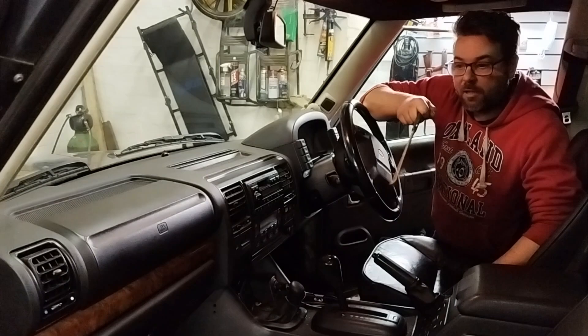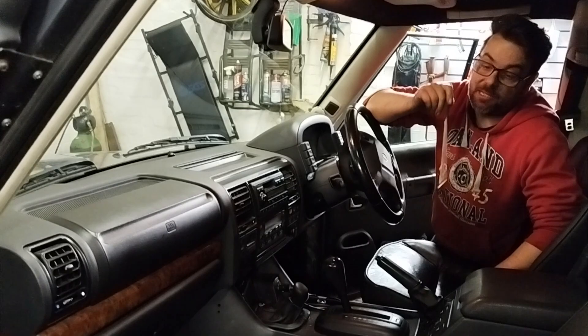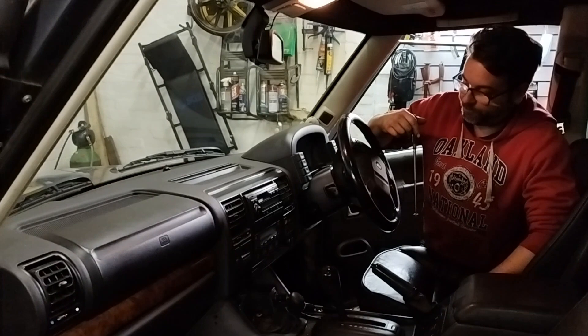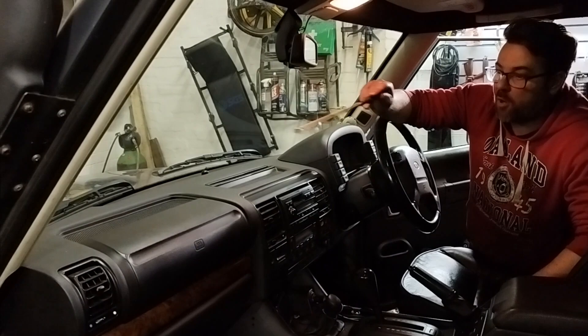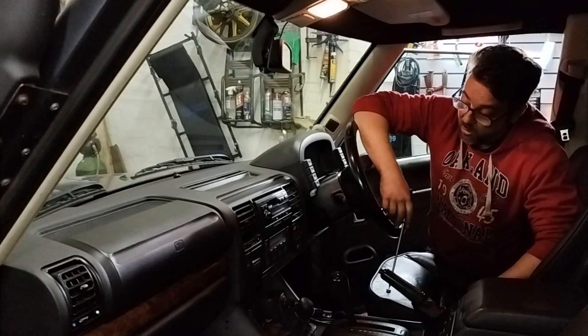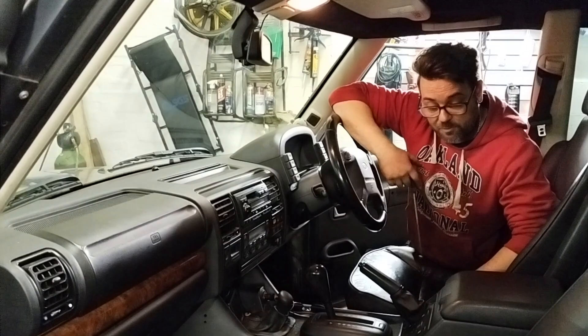Check your radio has a code, because it's a nightmare to get a code for the radio. If you can look in the owner's manual or service history, see if there's an EKA code — if there is, that's brilliant, because if you ever get into trouble with the immobiliser you've got the code to open the car. Check all your electrics. These can have a noisy fan — put it on full and check if it's noisy, because that means a blower motor replacement, which is a nightmare without disassembling the dashboard. The clocks often don't work, so a working clock is a bonus.